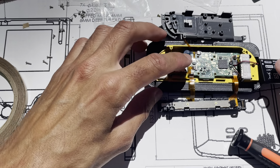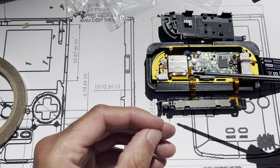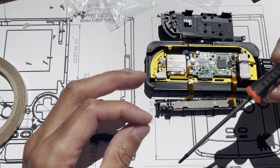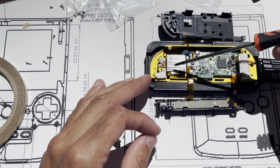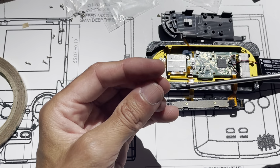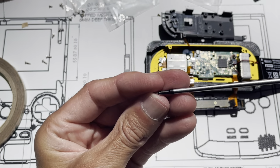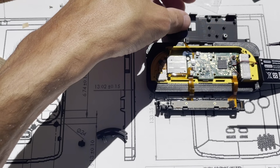Okay, just got that. So now I use the smaller, so these are 2 millimeters. So these are the shortest ones, right? Because you're only doing the board thickness. The joystick, 3 millimeters, which is the medium size. And then we're gonna go back to the smaller 2 millimeter size and attach this board only on the holes.